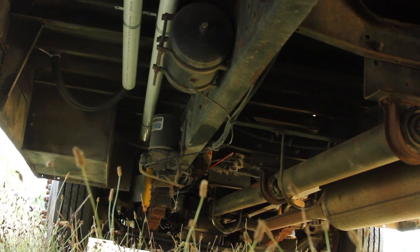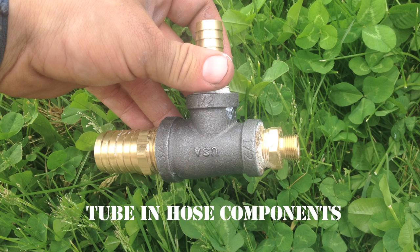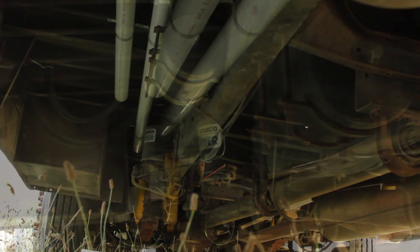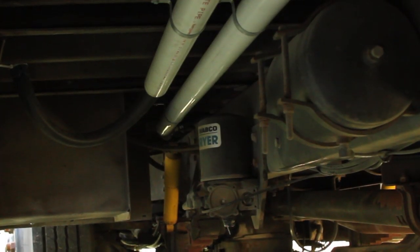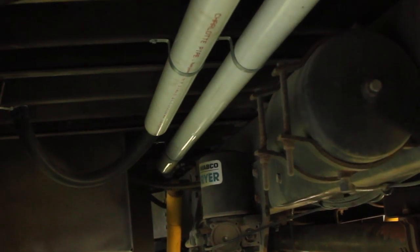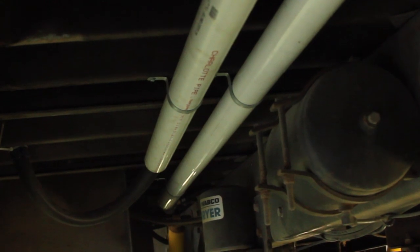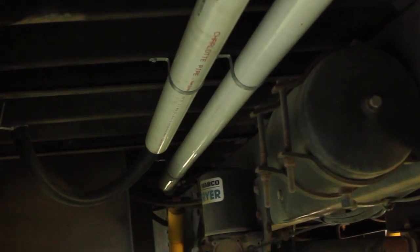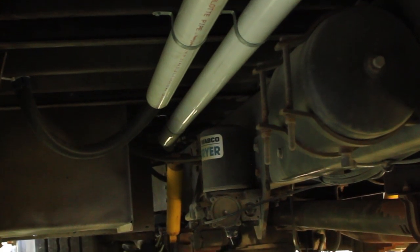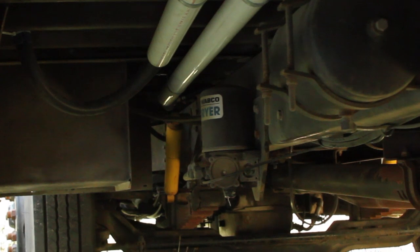It uses a couple other components too — a pipe T with several different fittings, and you can see more about that on our website. You'll notice under here there are two different PVC pipes. We wrapped the coolant hose in pipe insulation from your local hardware store and then put that inside a PVC pipe, so it's protected and insulated as the vegetable oil flows to the front of the bus. Each pipe has coolant flowing through it — one is coolant coming from the engine going back to the hot stick in the fuel tank, and the other is coming out of the hot stick and going back to the engine.